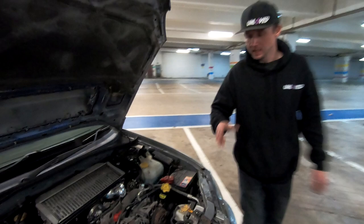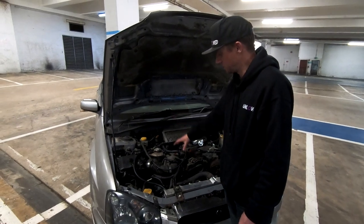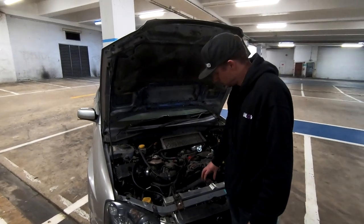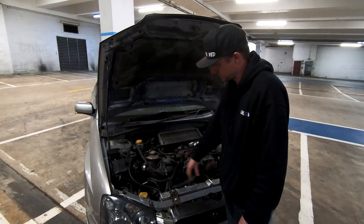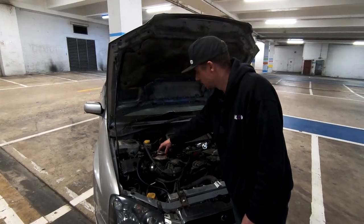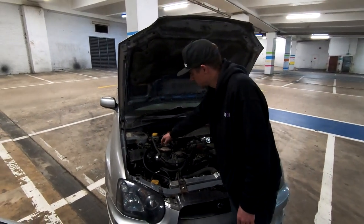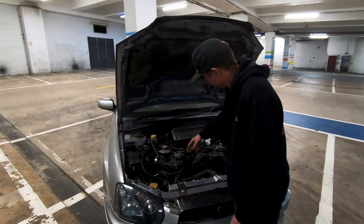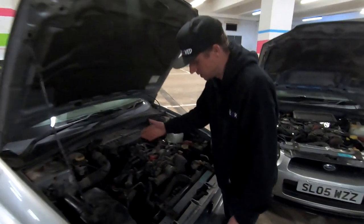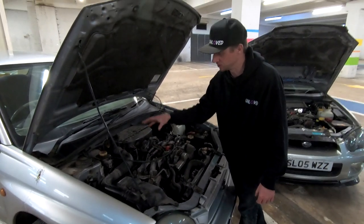The radiator is different as well. One of the issues with using the classic engine block is that the water pipe comes out at a slightly different angle compared to a new age one. The biggest issue was because of the header tank style setup: there's one that's constantly feeding to the top of the radiator — which the non-turbo doesn't have — and then there's one on the overflow which runs slightly differently. You can tap into it, but it was tricky to get right. On the non-turbo there's a little outlet where the header tank would be, but since it's not there it's not relevant.